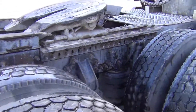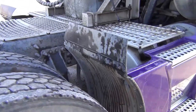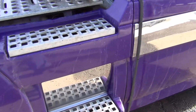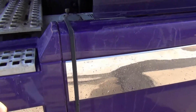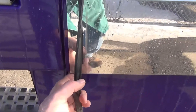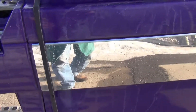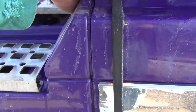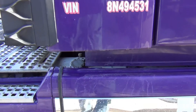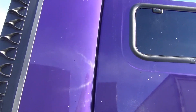There's rusting here too — you can see through to the base metal. There's a lot of gravel flying off tires over time. We're going to replace the rear tires; they're quite worn. I've got a bungee here — obviously there's a loose piece of something underneath that will need to be reattached. Usually it's a matter of getting in behind the fuel tank and finding out what bolt broke. This side of the sleeper looks good.